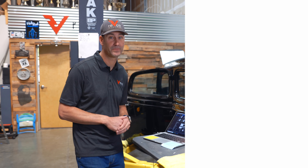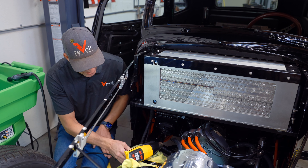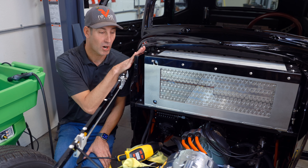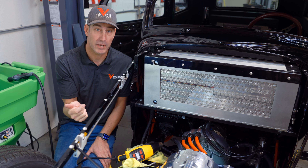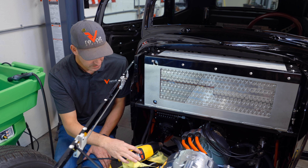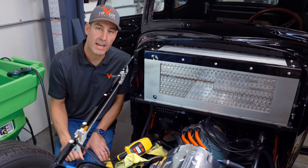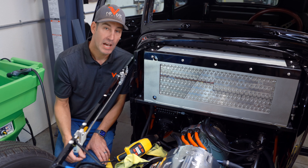What we're going to do is warm up the battery cooling system just a little bit. I have a heat gun turned down to a very low setting so we don't cook anything. Basically I'm blowing this onto the radiator that pumps fluid throughout the entire cooled system of the battery pack — I want to make sure the temperature comes up evenly throughout all 16 modules. We already checked for leaks, ran the system for a few days to make sure nothing's clogged and everything's purged properly. Now we're going to heat test it to make sure it's cooling and heating properly.